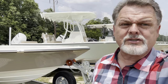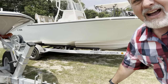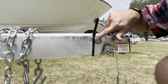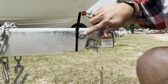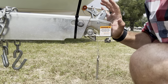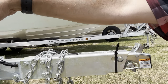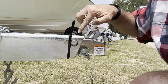Now, on a lot of boat trailers — not every, but most — boat trailers have a surge brake, which is a hydraulic braking system. As you're going down the road, do you see this little area right here? I've got a strap here to hold it back, but when you go to brake, the gravitational push or inertia of this trailer coming towards your tow vehicle will actually press back in here, which then puts the hydraulic fluid that's right here back up into the axles, which then creates the braking system. So this is a surge brake.